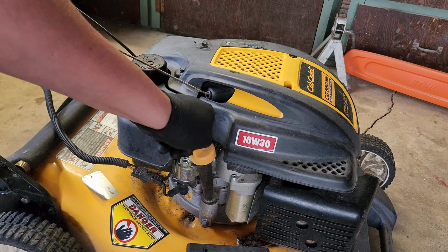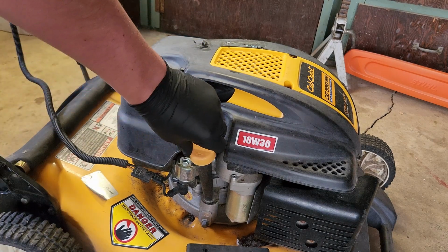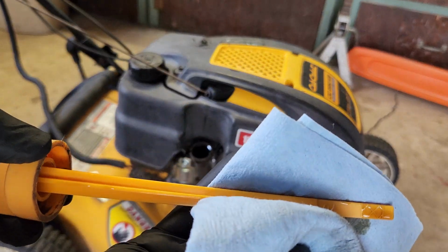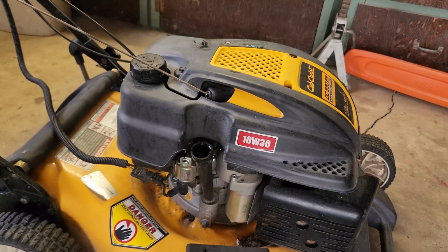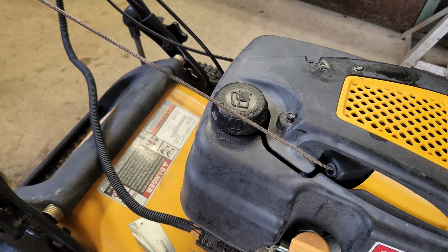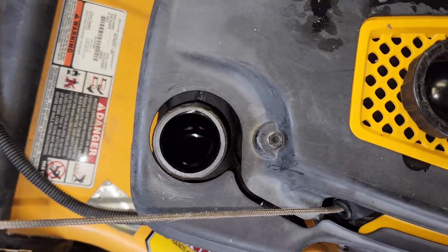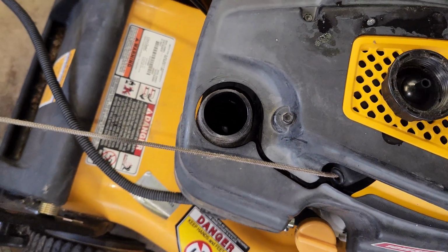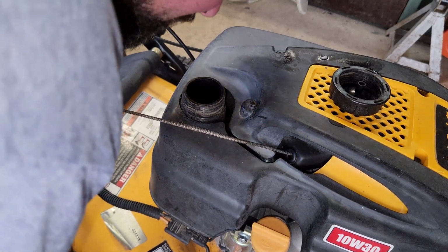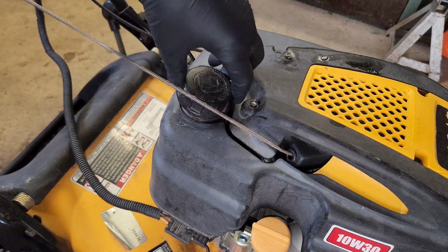Let's start with some basics. The tank cap. It's a quarter turn cap, which is nice. Probably not necessary to turn that. Oh yeah, right up on full, nice and clean looking, and very minor amounts of fuel in there, so that's good. Tank check. Maximum 10% ethanol. Have a look. I do see the presence of liquid, quite a bit. I think he said he added some, so that would make sense. Let's do a water seal check here. Nope, that's definitely fresh gas, or fresher gas.